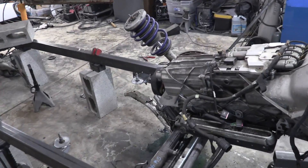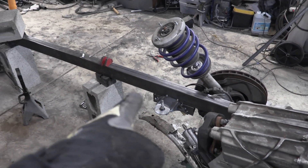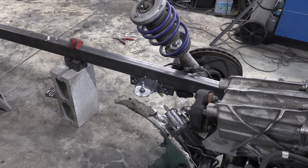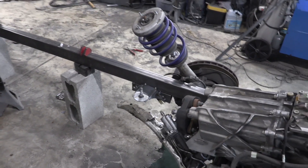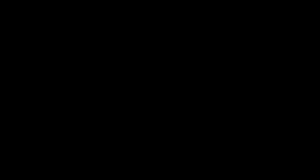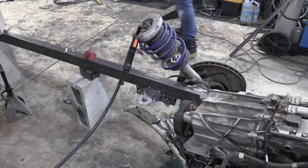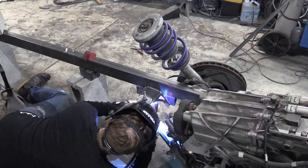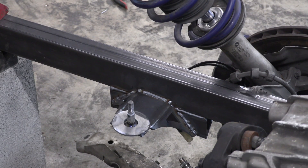Engine is out and we're ready to fully weld up our mounts. You can see there's a one-inch difference between the two sides. I had to add a couple more tack welds on one side — a couple popped when pulling the engine in and out. I'll grab the flap disc and grind them down to make it as pretty as possible, then fully weld both up top and bottom. That's one down — the tack welds made it a little messier than needed, but it still looks pretty good.